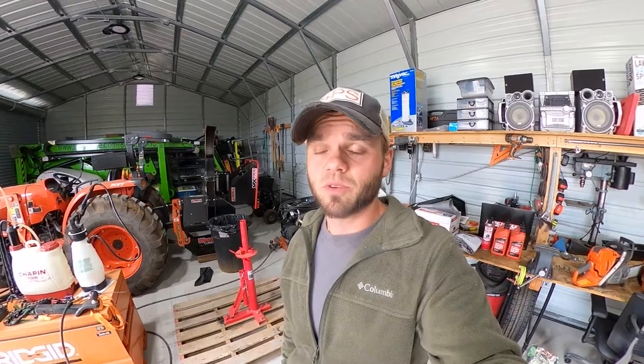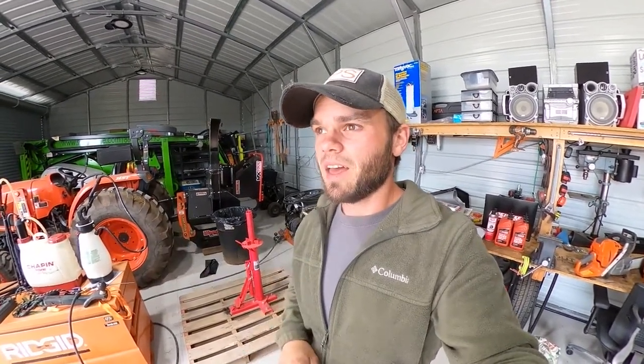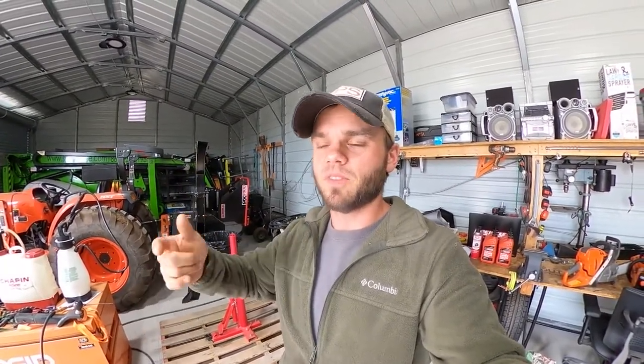It's Saturday. I worked about a half day and I noticed my trailer is getting a little skip to it, because of a tire that needs to be replaced. I've known about it for like four or five weeks now, but it was kind of okay. Now it's not okay anymore because it's bouncing to the point where I'm actually noticing it, and also the tread's almost gone off of that bad spot in the tire. What's going on is I've overloaded it multiple times and the tread's actually separating, and it's got a bubble in it. So every time the tire rotates it's slap, slap, slap — if that makes sense.